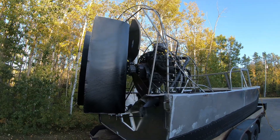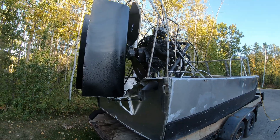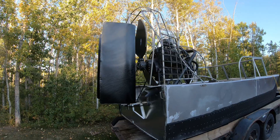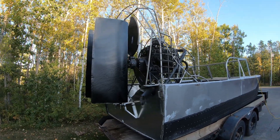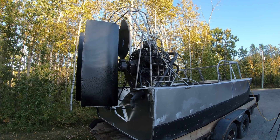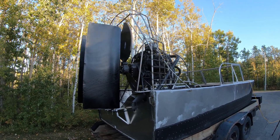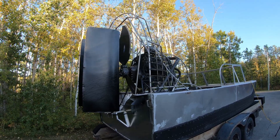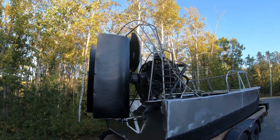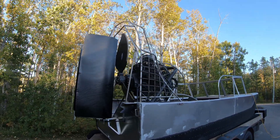The plan for right now is I'll spend some more time tuning it. I'm going to get it off the trailer and put it in the field and just see if I can power around on the grass. I definitely need more pitch on the prop — it's too fine right now. It spins up too easily. At just quarter throttle it'll go to 4,500 RPM. So I'm going to put a lot more pitch into it to build some boost. It throws a lot of wind right now, and that'll get even more so with more pitch. See ya.